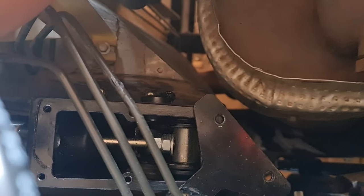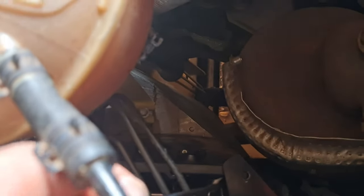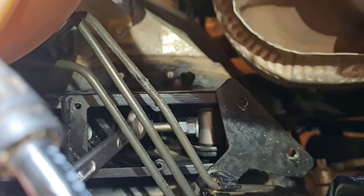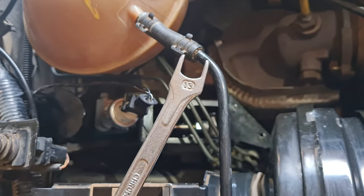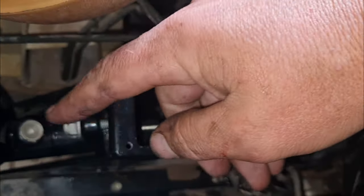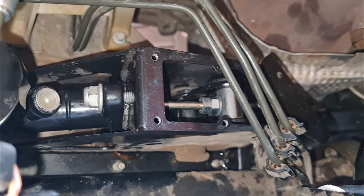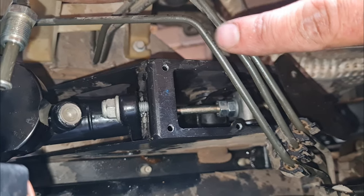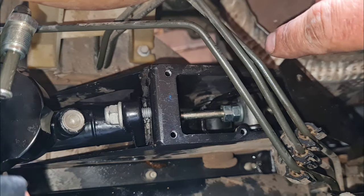Okay, guys, what we've done also is we had a spare 13 that we ground like this. So if you look at those two nuts that you use to adjust the pedal, to tighten them with a normal spanner is quite difficult. So if you use something, wedge that forward, and then on this side it's quite easy to tighten it using a spanner like this. I've pushed the bolt through from inside and just hand tightened the nut there. That gives me an opportunity to properly tighten it. As you can see, I've got my two nuts and the washer on that side. Once everything is tightened down, I'll compress the clutch again and put the lock nut in from the back side. After that, it's just closing everything up and bleeding the system.